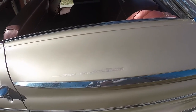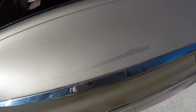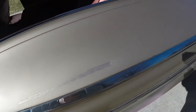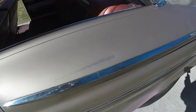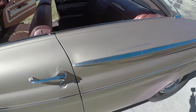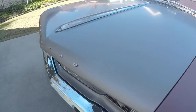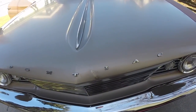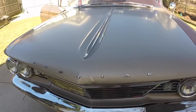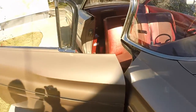The thing with doing brush touch-ups with metallic — you get too much metallic and it doesn't flow out right. It looks like the paint matches close enough to where I'll bump that, fix it, and paint it properly. And the same with the hood — I'll fix that properly and paint that spot too. I think the paint will match good enough from the looks of the door jamb. It looks pretty darn good.